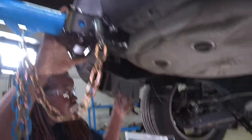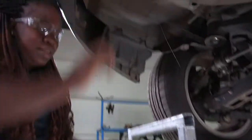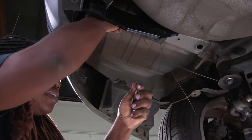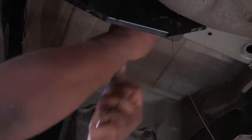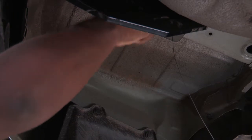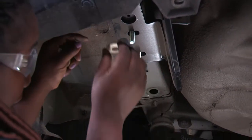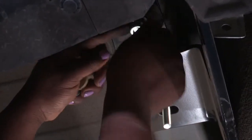Our next step is to remove the fish wire and put the nuts and washers on. You can screw them off or just pull them straight off — they'll come right off. Once the fish wires are removed, you'll put the washer on with teeth face up towards the hitch, then use the nuts to twist it on. Hand tighten these until completed on both sides, including the passenger side.